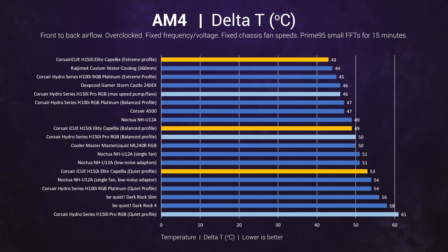The AM4 system places greater strain on the coolers. Once again, equivalent profiles produce better results on the new cooler, but this time at least part of that is due to higher fan speeds — both quiet and balanced profiles result in fan speeds higher by about 200 RPM. The thermal improvement on quiet is still very good. At extreme, the difference in fan speed is over 500 RPM, and the final fan speed of well over 2000 RPM is indeed on the extreme side. The cooler gets a chart-topping result against the competition, but at noise levels most will find excessive.